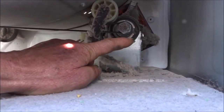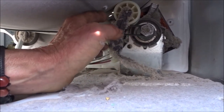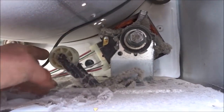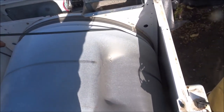You can check and see if you have a good belt. If we look in here, we can see how this belt goes on — the idler basically goes around and then around the pulley as well. The way I usually take this off is just push this forward and pull the belt out of here like that, then grab the drum with the belt and pull it out.